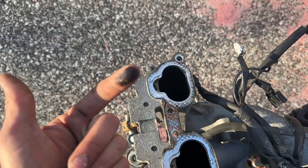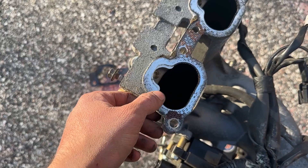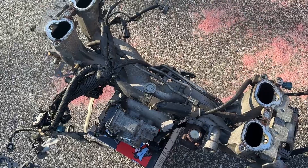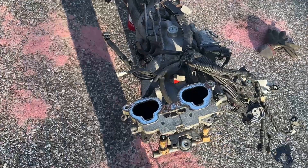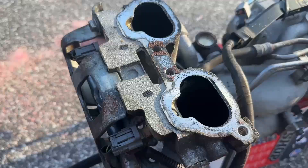There's quite a bit of oil caked up inside the manifold — worse than I thought. I'm going to clean that out with a putty knife, razor blade, and scrape off the old gasket surfaces so the new gasket sits as sealed as possible. Using my throttle body and air intake cleaner — the difference is night and day. I've already burned through an entire bottle and it's still pretty dirty inside, so I'm going to have to run and pick up some more.